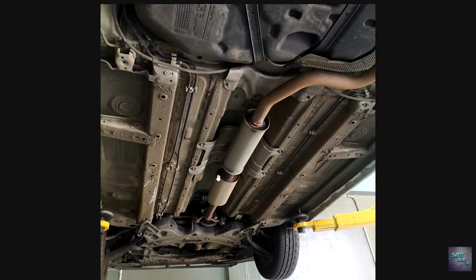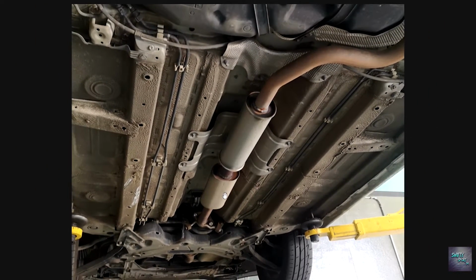Here we have the standard resonator that comes on the Suzuki Swift Sport. So we decided that day, as a quick fix, to install a free-flowing resonator to follow that one, which eliminated that irritating raspiness that I did not like. And it really worked. But it made the car only ever so slightly louder after doing the decat. So the level wasn't where I wanted it, but the tone was right. Remember, a decat gives you that rally kind of feel. So I was very happy after adding this second free flow silencer or resonator.